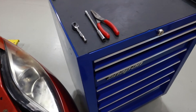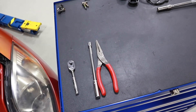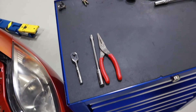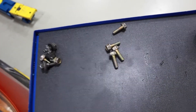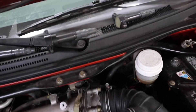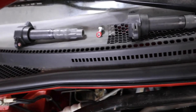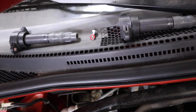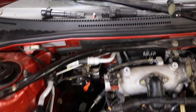A side note I want to point out is that with a job like this that has a handful of different fasteners and things, it's important to stay organized and keep track. So I do my best to keep my tools laid out and do piles of fasteners — these were my ignition coils and then these were some of the airbox components. I've set my ignition coils up on the cowl to keep them separated, and this bolt that helped with a wire harness bracket lives between cylinders one and two, so I've got it sitting there between coils one and two.